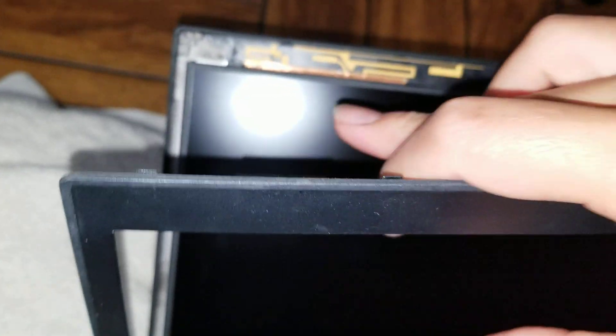To remove the screen, like all the other ones, there's actually an adhesive around the frame, so it's going to be tough when you remove it. But if your screen's broken, it shouldn't be an issue. You basically get between the layers and pull it up. As the thing twists, it undoes the clips. You'll have to pull kind of hard because there's adhesive all around the frame of the screen. There's some of it still on here — it goes all the way around, which makes the screen tough to remove.